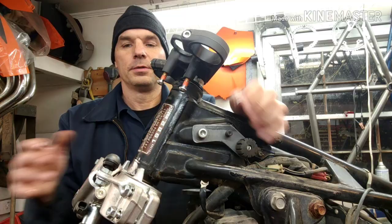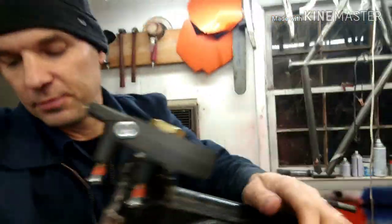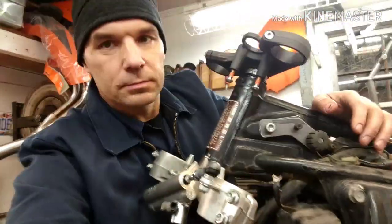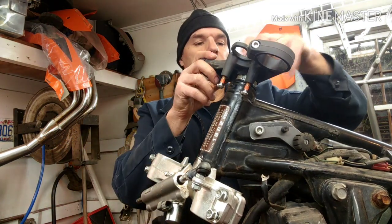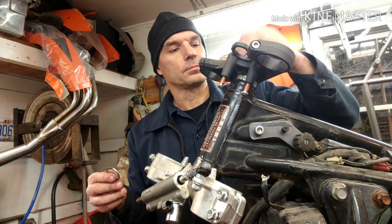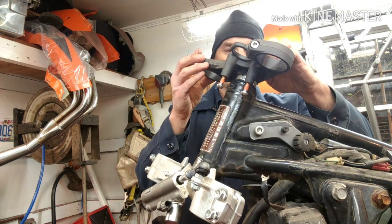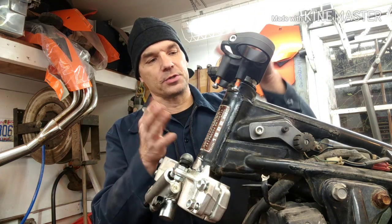The nut on the top here is not on all the way. See that? Because of the spacing that we have. The lock nut that you already saw, I can't get the washer in between there. So there's a washer up here. If we take that washer out, I can get this nut down all the way so it's flush in the top. And that will probably work fine. You know, when you put all the stuff together and you clamp these triples, they're not going to slide.